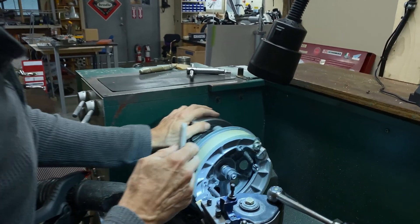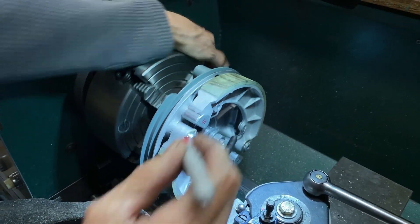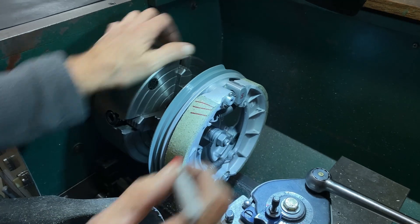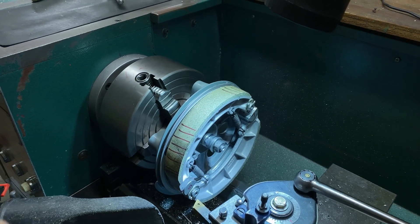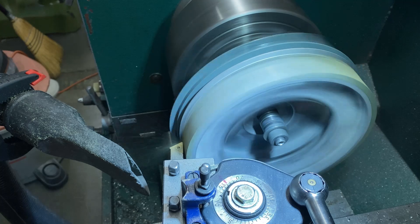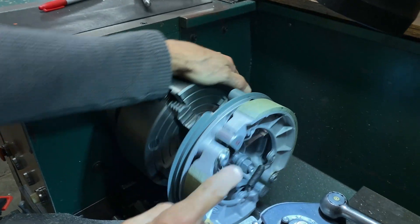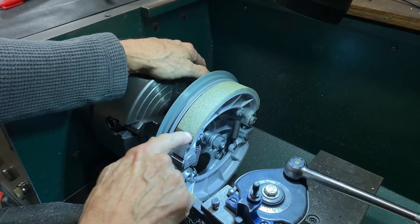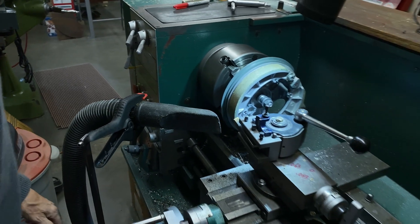I want to show you something here — see how it's touching here but it hasn't been cutting here. I'll make some marks here and then you can see as it comes down. This one seems to be cutting most of it, so the shoes were pretty good to start with. It does look like it's cutting — anyway, that just shows us where it's not cutting. All those felt pen marks I made are all gone now. So these shoes are basically arced, which means there's contact for the whole shoe. We just aren't down to size yet, so we'll do another cut and then take a measurement.